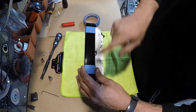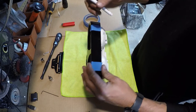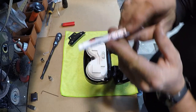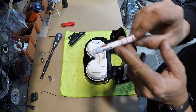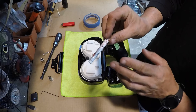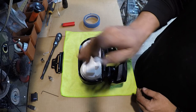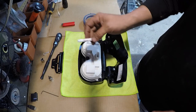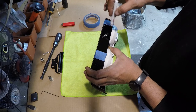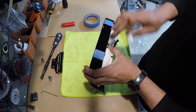When I put this on I don't want to go any further past that so it doesn't leave any marks on it. We're going to apply 3M Primer 94. This primer 94 is a one-time use — once you break it, you've got to use it. They're asking for a thin, uniform coating, and once it's on we need to wait five minutes for it to properly prime the surface.